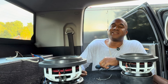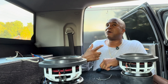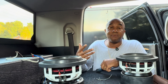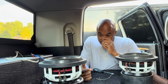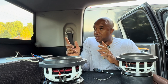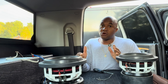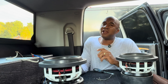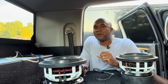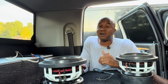The back window of the Ford with the 1506s got louder with all the rest of the windows up. That's because of the reverb — you actually had a box playing in a box. When you open that back window of the truck, that becomes another port. Now you got a series tuned 6th order, and this is a very large chamber. Even in a quarter tune, that's a very large chamber.